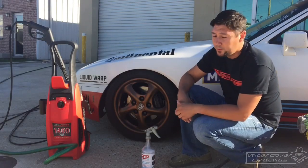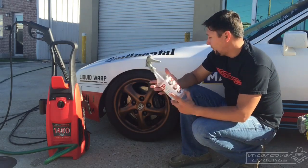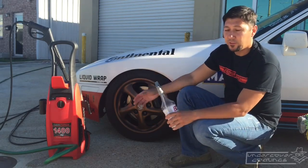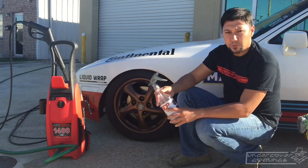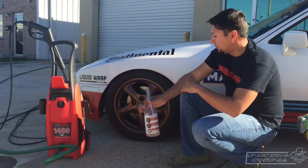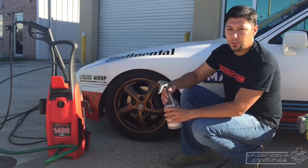For this portion of cleaning the vehicle, you're really only going to need two things: BDP and a pressure washer. BDP is an amazing brake dust releaser — a touchless wash product that really amazes me every time I use it. You spray it on, leave it for about two minutes, and do not let the product dry on the wheels. Also spray your tires too, because brake dust and grime is part of why your tires don't shine. After it soaks for about two minutes, you're going to see a lot of purple slime coming off the tire and wheel. Hit it with the pressure washer and rinse it off really well. If you see any rust-type staining, just spray a little more BDP on the tire and hit it again with the pressure washer and those will clear up.